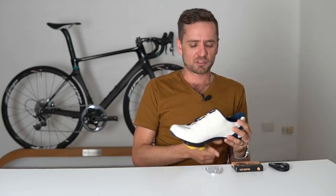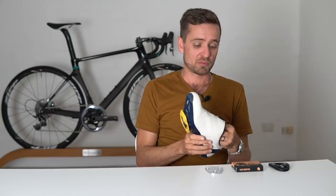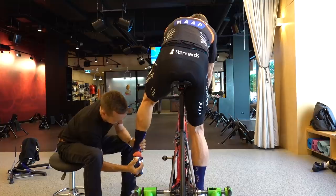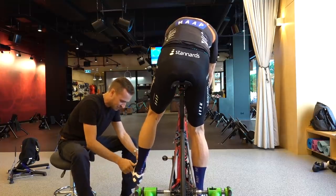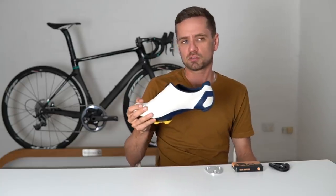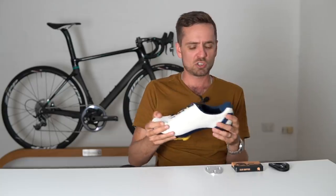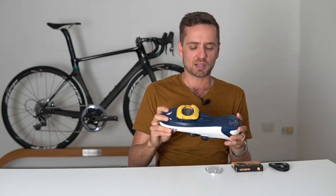The other benefits are that the seat goes down and aerodynamics get better. It does help if you've got foot numbness that's really persistent or circulatory issues in your feet. If you've got oddities — like one foot significantly bigger than the other, or a big leg length difference — it can help to stabilize certain types of riders and reduce other issues because it takes the foot's lever out of the pedal stroke. It just kind of deletes that section of the biomechanical puzzle.